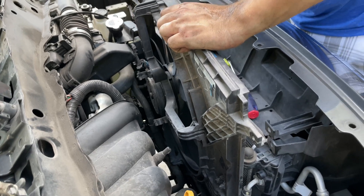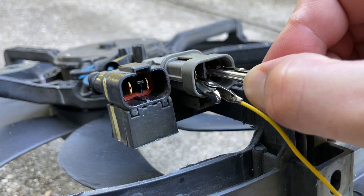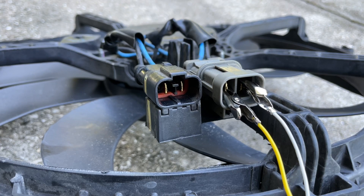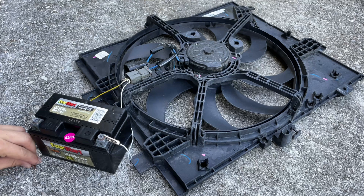You can also try to supply 12 volts directly to the fan if it's possible to do so easily. On some cars, you can't get to the fan connectors unless you take out the entire fan assembly. Connect the 12-volt battery to the wiring harness — black is usually the negative side and red or blue is the positive. One connector is for high fan speed and the other is for low speed. Test both connectors. Here is what a brand new fan looks like, and the old fan is not spinning at all when supplying power to it. Once you verify the fan is broken, go ahead and replace it.